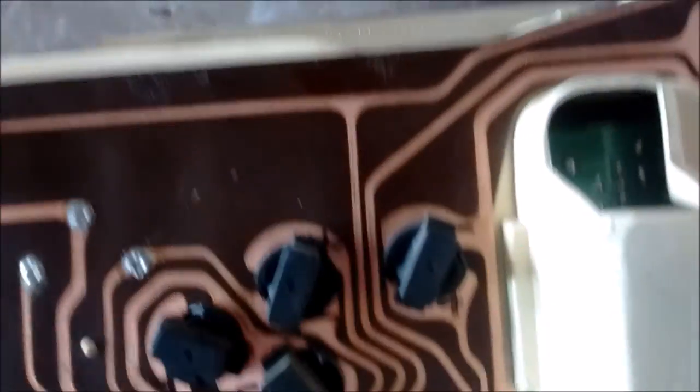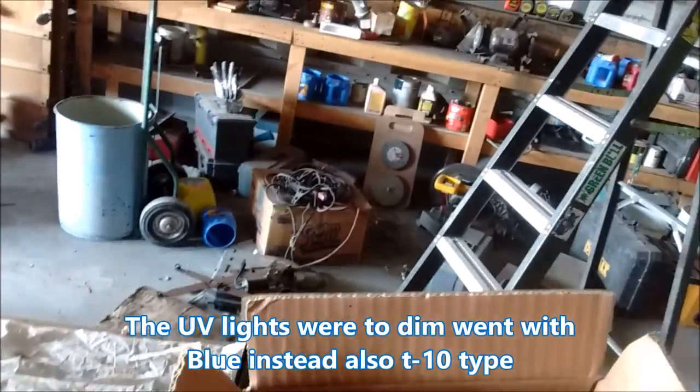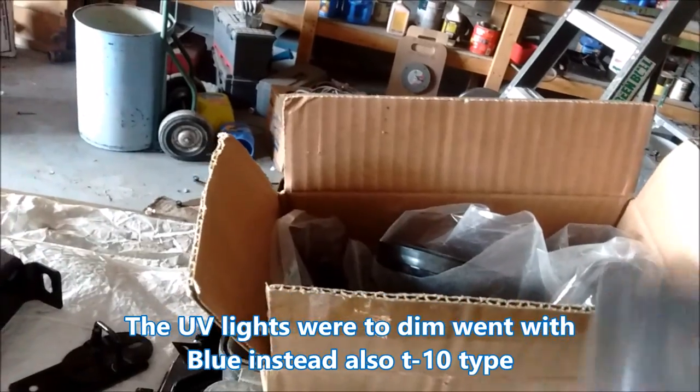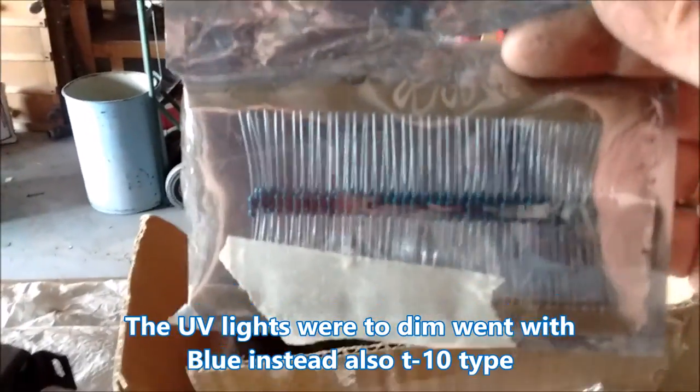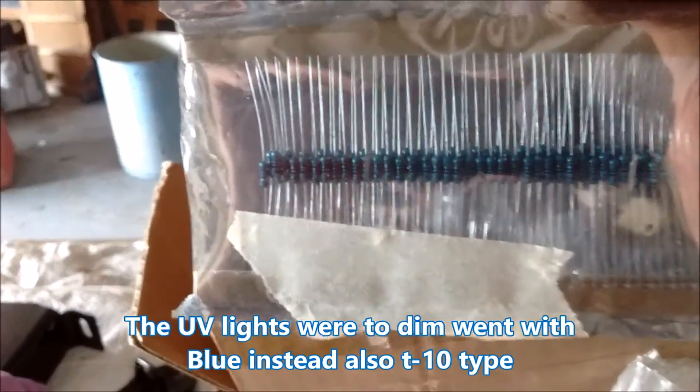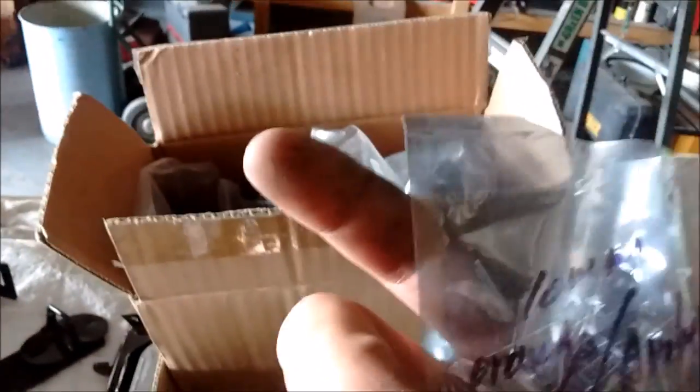You have to determine negative and positive when you put in LEDs. I've got a whole kit full of LEDs here. Here's my UV 10-millimeter LEDs. You've got to add resistors to the positive side because 12 volts is too much — you've got to reduce it down to about four and a half volts. I got a set with some LEDs — like a hundred of them from eBay — and also some amber ones I was going to use for my clearance lights.